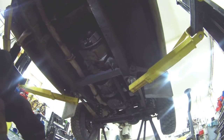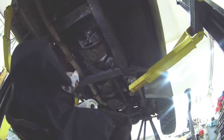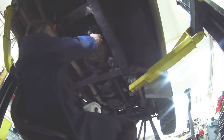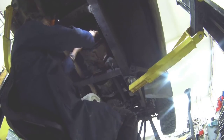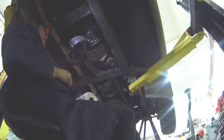Both springs off, it's all very loose — that's all there is that holds this in. So, drop the shoes down a little bit and now you can see why you need paper towel — because grease is spread all over the chassis and exhaust and things, and we'll just wipe all that off. Drop the shoes down, push it out with your thumb, push this out and pull it forward and then it's off on the other side too. Bring it forward, try not to drop it on your head, and just ease it over these adjusters here. These adjusting pieces can fall on the floor and if you're doing this outside and you lose them, you're really going to be stuck. So try not to lose these things — sometimes it's a good idea to put a rubber band around them if you're not so sure.